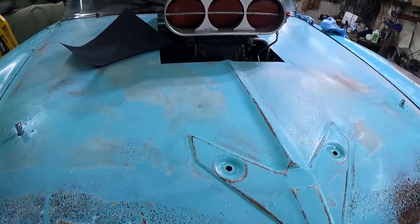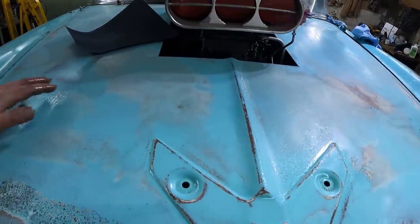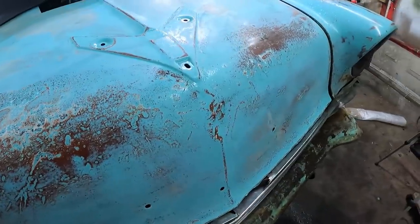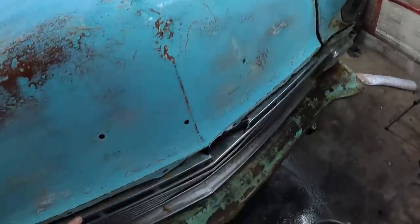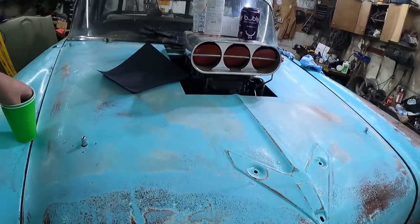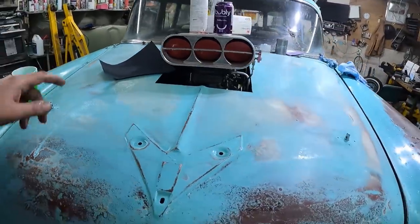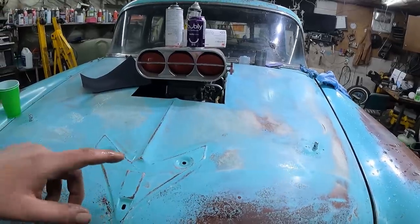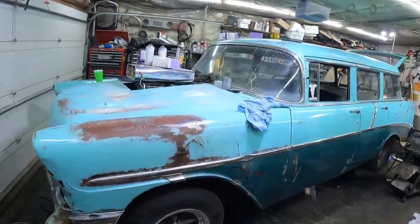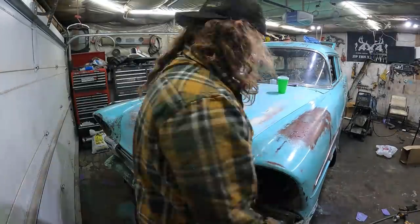That's what the 1000 grit is going to do. When I was sanding I basically went down till it got smooth — that was the goal. A little ice water for my burned hand. The front might need a little bit more. I want to get a Bowtie emblem and a little Chevrolet badge — I do have the chrome for it — so that'll draw your eye away once you get the headlights and trim rings and all that. It'll look nicer overall. I think it's coming. I'm going to sand with the 800 or 1000, smooth it all out, clean it one more time, then polish it. We'll leave it there until I can bring it outside and show you in proper light — it looks really good in daylight versus this LED junk.